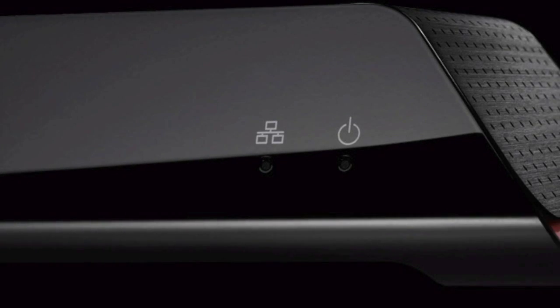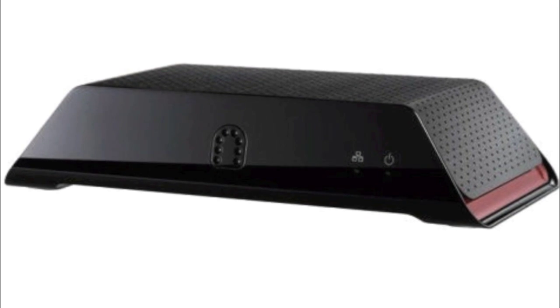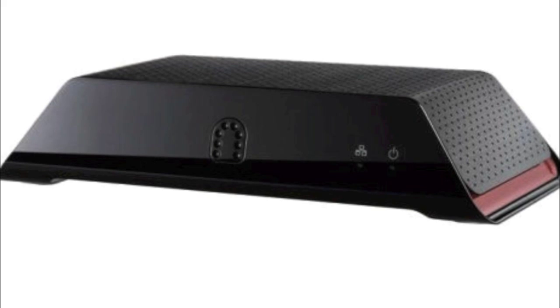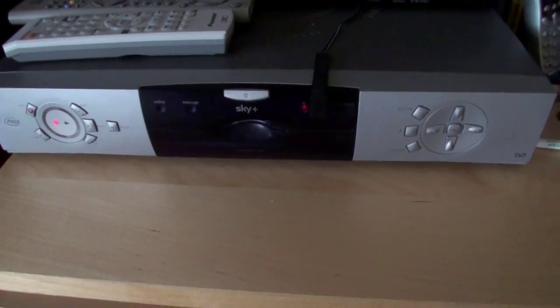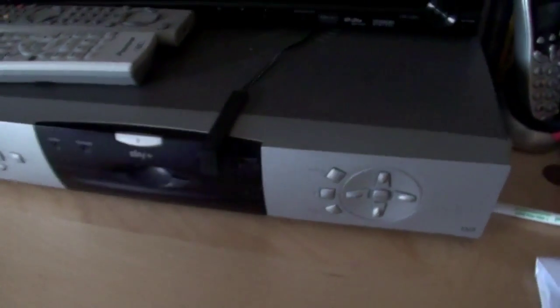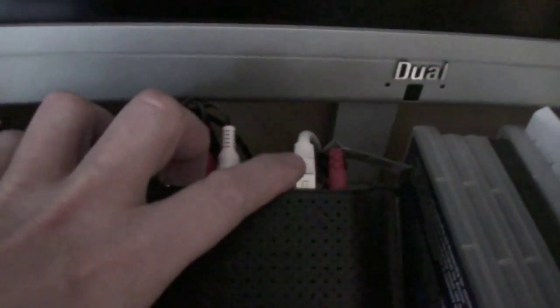So I've got one of these instead - a Slingbox Solo. The Slingbox takes regular analogue audio and video inputs and translates them into digital video that can be viewed either over the internet or via Wi-Fi. On the front of the Sky Plus box in the bedroom there's an infrared emitter which goes into the back of the Slingbox, enabling it to change channels from the remote destination. The network cable on the right goes through a wall into another room and into the back of my Apple Airport Extreme.